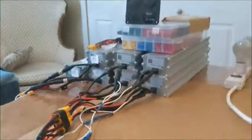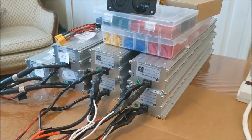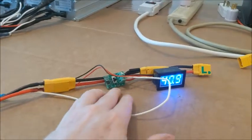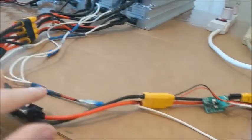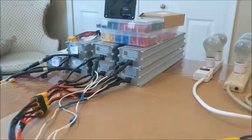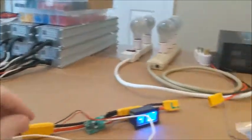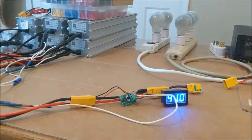What I've got going here is four good batteries, all charged to 41 volts. I've got them running power through a pigtail that I made. The pigtail comes down through the BMS activator board, which goes out and attaches to the actual blue wires on each one of the scooter batteries. I made sure that each one was out of hibernation by taking my voltmeter and hooking it up in line on each one to make sure it showed voltage.